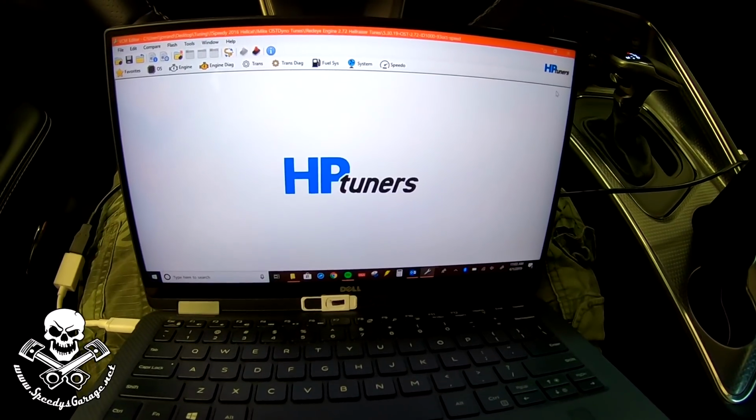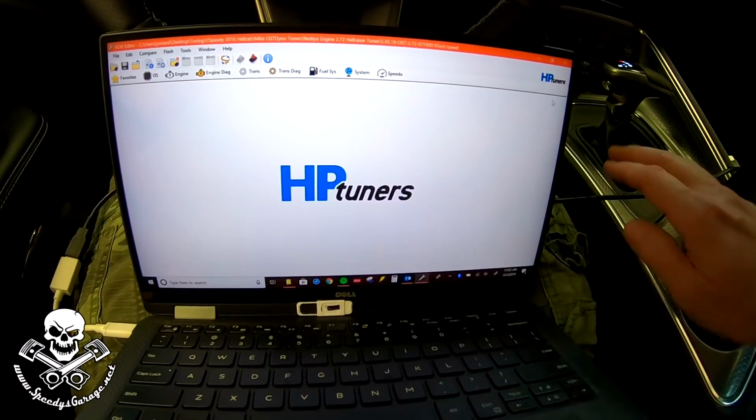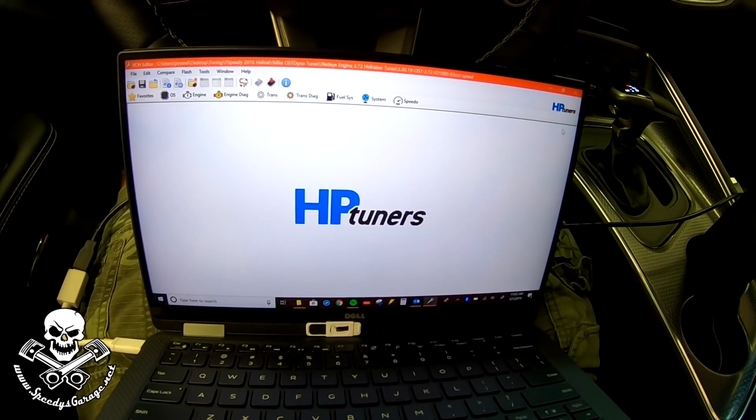And of course, we're going to use HP Tuners to tune the car. So I've gone ahead and loaded that up and got it connected to Go Man Go. We're going to load up our first revision. I did some videos on that a while back. I'll try to link to them there so you can go back if you're curious how you do this. It's very, very easy. You basically grab the tune you want. Select if you want to write the transmission and the engine. We only need to write the engine in this case because the transmission is already set.